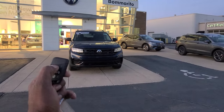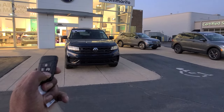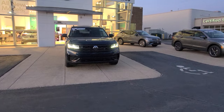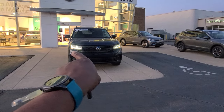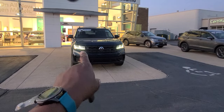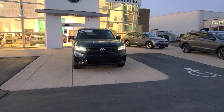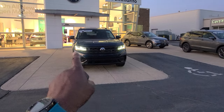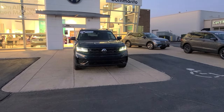So you hit the lock button once, the lights will flash, and you hit the two-times button twice. The car will start up. The daytime running light hockey-stick lights here will light up on both sides. If you have an SEL, you'll get two lights on each side. If you have an SE Tech, you're only going to get one set of outside lights on either side.